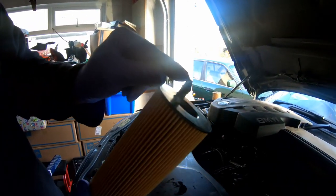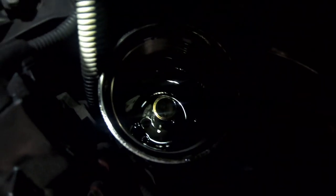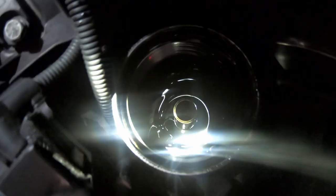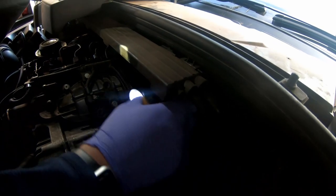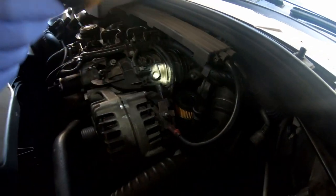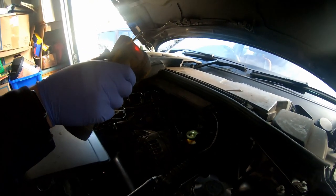With the oil filter, there's this little spigot on here. If we look inside the oil filter housing there is the hole that goes down the center where the oil comes into the filter, and then there's another little hole just next to it - that's where that little spigot goes in. So obviously we need to make sure to get the orientation right otherwise the cap won't go on. I'll get it in there now, push her home, and there we go, that's it fully home. What we need to do now is just prep the cap ready to go back on.